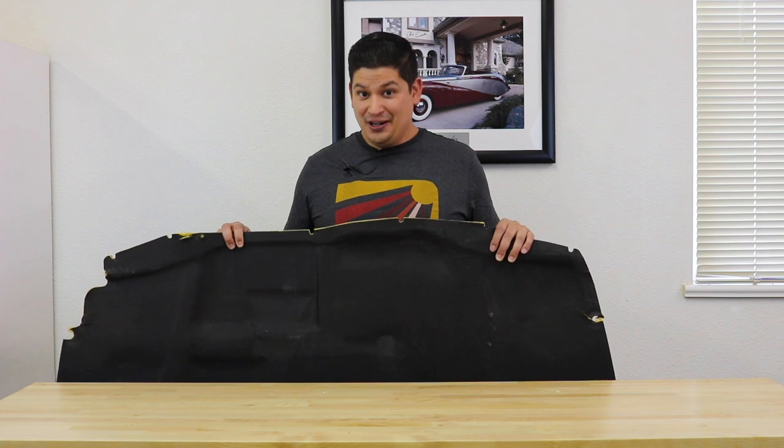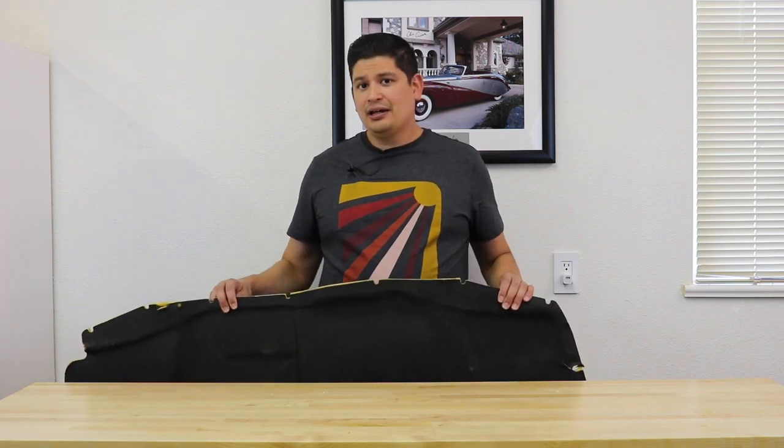In the end, this is a fire blanket. It does help reduce noise — you definitely hear the turbo spooling a lot more without it. In certain applications like carbon fiber hoods or high-HP cars, this can lead to some paint issues depending on engine bay temperatures. But overall, a lot of people have had these off without any issues. My main thing is I would still have mine if it didn't break, but I found it a very interesting topic. Thanks for watching — subscribe, share the videos, and stay safe.